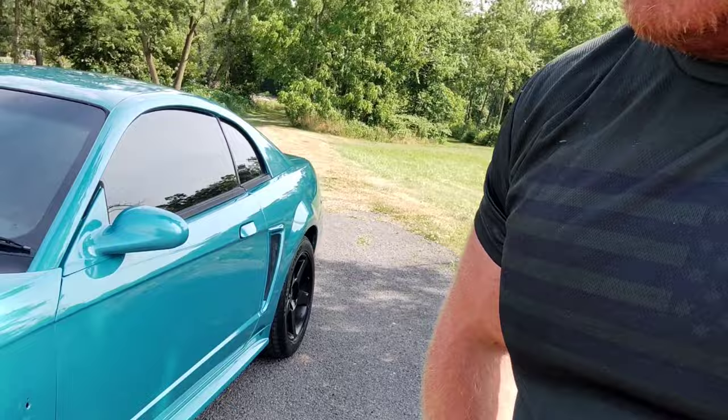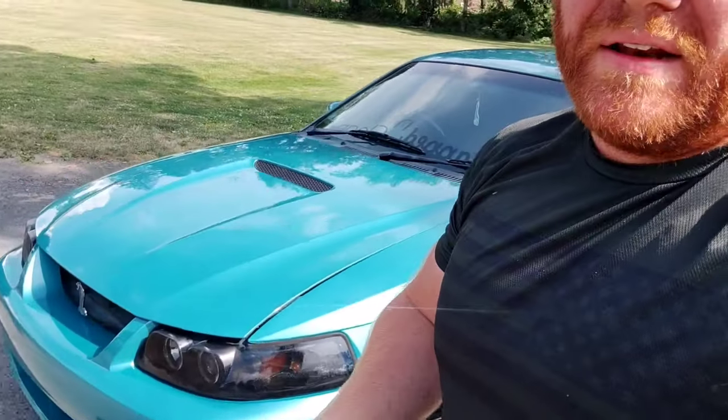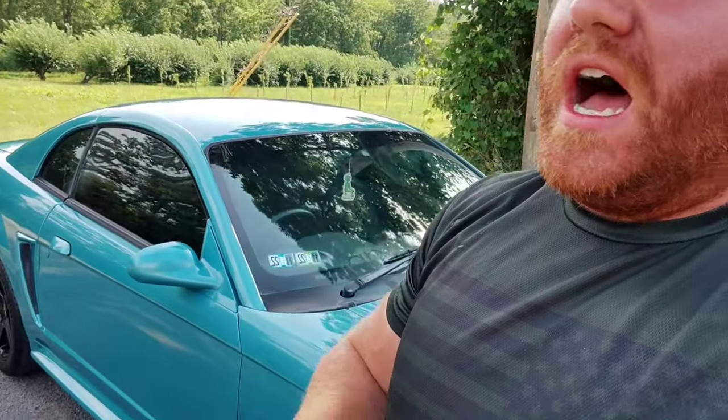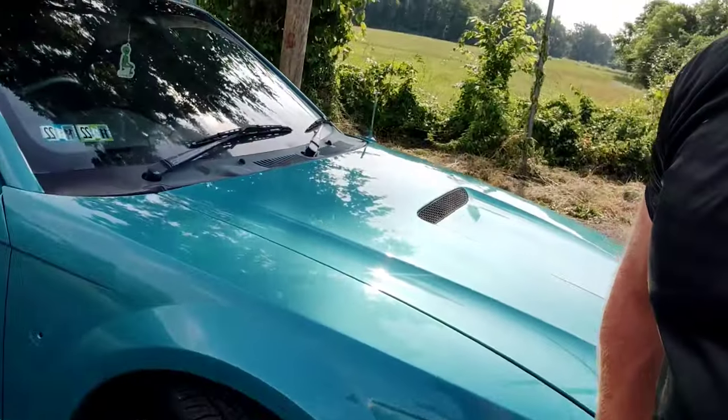So in turn, to fix that problem, we went ahead and dumped almost a full gallon of the Speedokote SMR42 clear on it, which did resolve the problem. First coat, we went pretty soaking wet. And then the second coat, I let it flash off really long, about 15 to 20 minutes, because I didn't want to get runs. The second coat, we dumped on even wetter, we got a pretty good result. No, didn't have any metallics popping through on the second coat of clear.